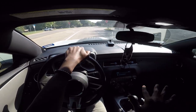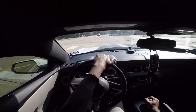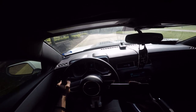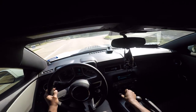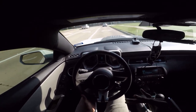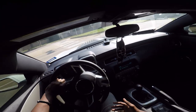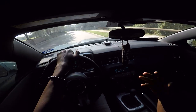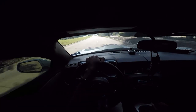If I find a clear road or a closed course I will show you guys some quick shifting in this car — I just don't want to do it with a lot of people around. My IATs are at 80 degrees right now; usually they're a lot higher than this, and it's 76 degrees outside with the AC on, so this car is working its absolute hardest. That heat wrap on the intake works so well. The app I'm using is the Fix app — it's an OBD2 sensor thing that shows engine codes, live gauges, and lets you do 0-to-60 runs, similar to a Dragy. I haven't tried the 0-to-60 feature yet but I want to try it on a closed course.